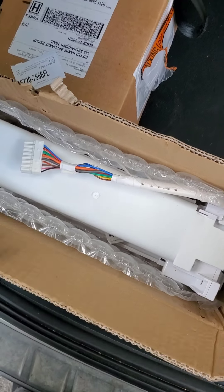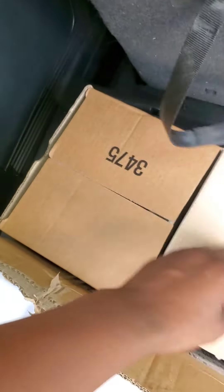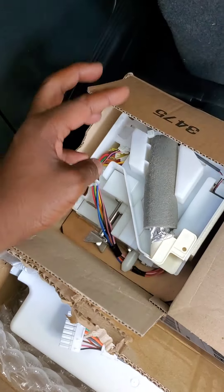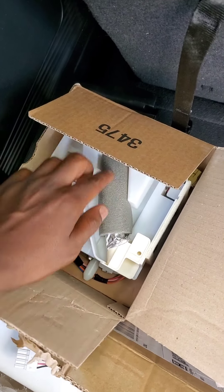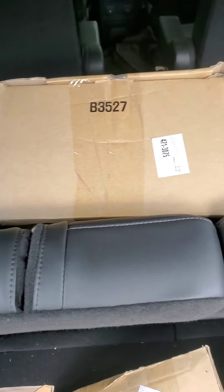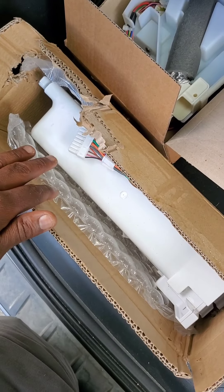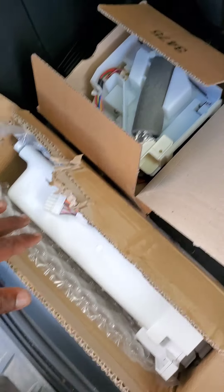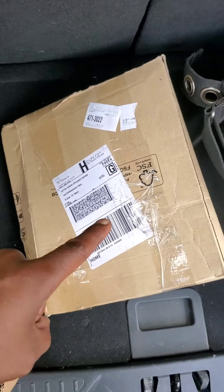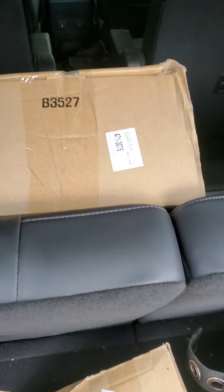Here's an ice maker. This is an auger motor assembly here. New auger motor assemblies come with this water duct heater. And then this is the ice bucket. So if you got a Samsung refrigerator and the ice bucket is frozen in, the ice maker is not producing ice, or everything is just frozen like a solid block — the main control board, the ice maker, auger motor assembly, and the ice bucket need to be replaced.